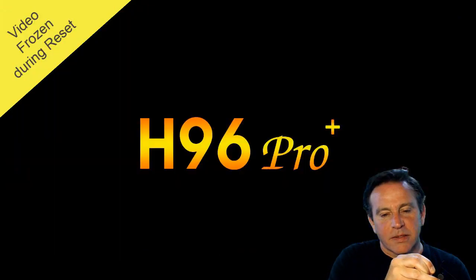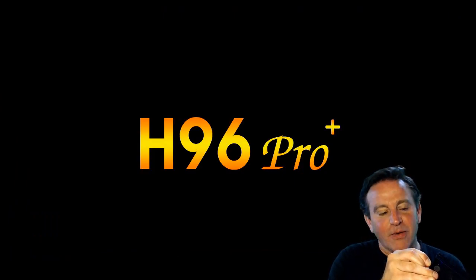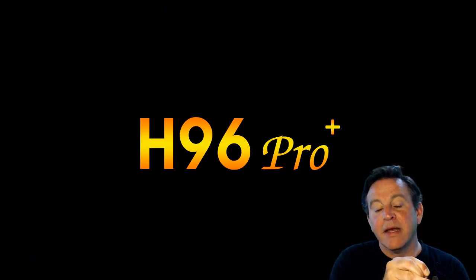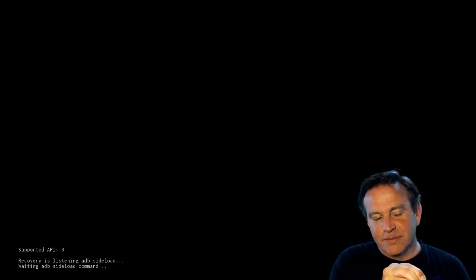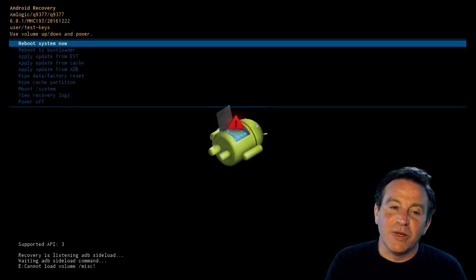All right, so it's rebooting and I'm holding the paperclip in. During the boot process, it's going to check that button and say, is that button still in? And if so, they're going to say, all right, we're not going to boot any longer. We're going to go to a special recovery mode for Android devices. Here we go. Yeah, Android recovery.